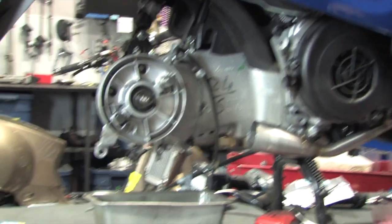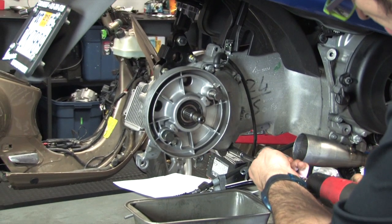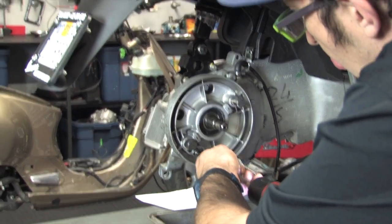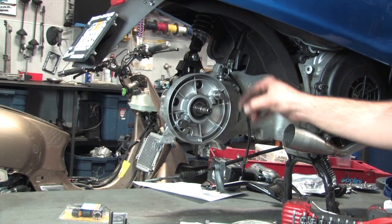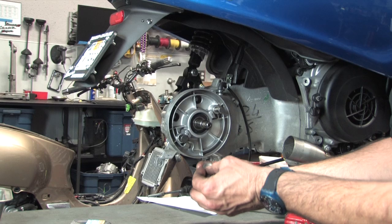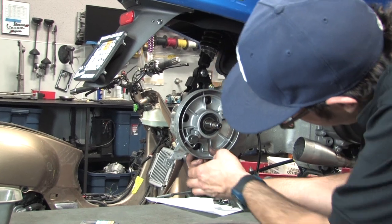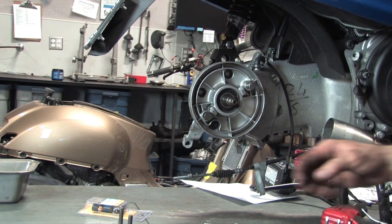I'm going to go ahead and snug them all — not doing the final torquing yet, just bottoming all the screws out. All eight fasteners can be torqued to 16 to 18 foot-pounds. All eight fasteners on the gear case have been torqued. You've got the little rubber plug — it looks different on both sides: the full round side goes on the outside, and the side with the little key faces this direction, down into the slot. As with any grommets, you just work it into place — and there you go, that's installed.